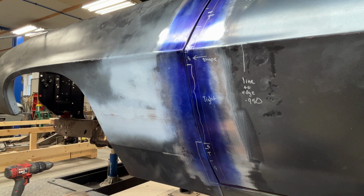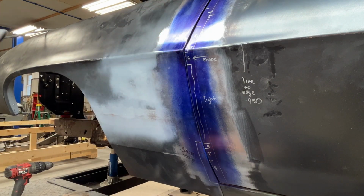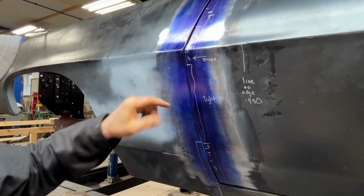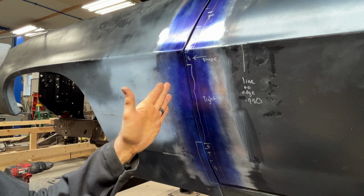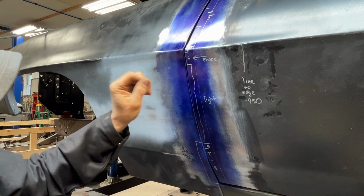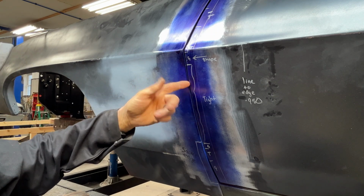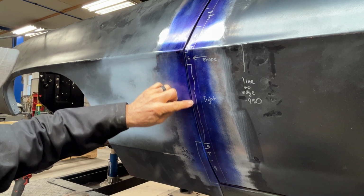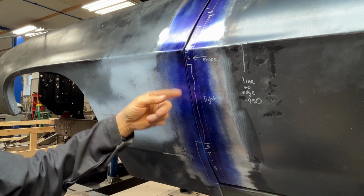So anyway, the next step, like I said, the fender once again will have to come off, and once I get the fender off, then I'll start doing the welds and slowly building this up and taking it out. Now, one thing I will say that I'm a little bit concerned with, if you've ever put a door skin on, these edges are straight and you actually hammer and dolly these things over. So the one thing that does kind of worry me a little bit is the material that I have to take off of here is going to make this edge real thin. So I'll probably cut this back just a little bit more, and I'll do this in small sections, and then I'll end up just welding this.